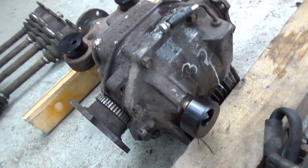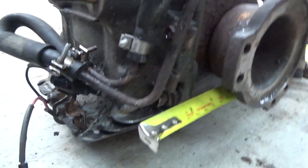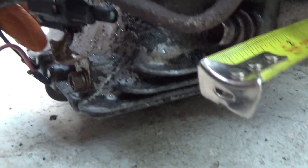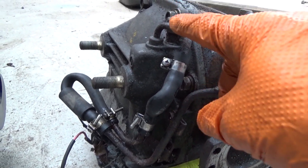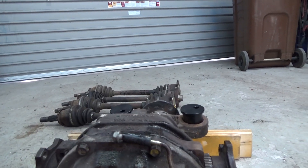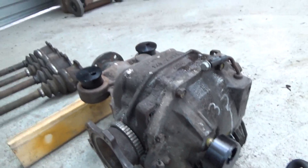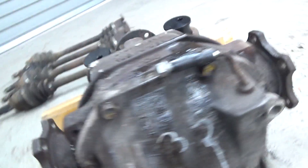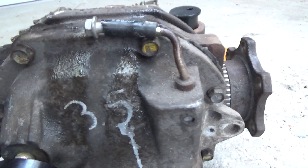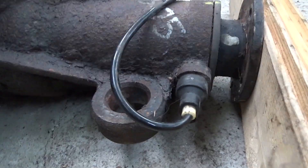Looking around them, there's a lot more stuff on the back of the S14 one — I'm pretty sure those are temperature sensors, and I used to run a cooler on my S14 as well. The 350Z one has really got nothing — just a breather, and that's about it. For speed sensors, the 350Z has a trigger wheel with one on each side for ABS, so it could tell which wheel was doing what. On the S14, the speed sensor was just one up top.